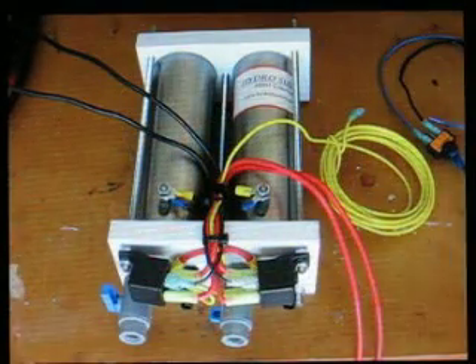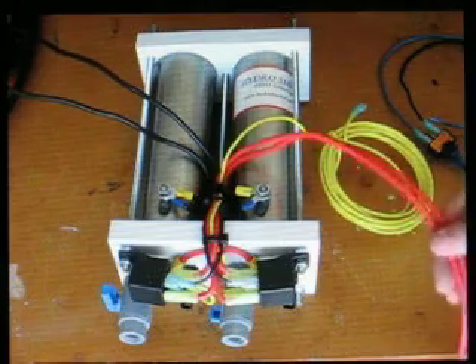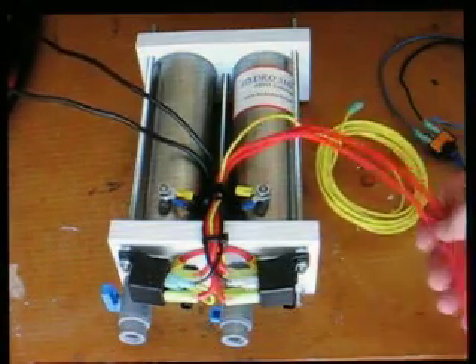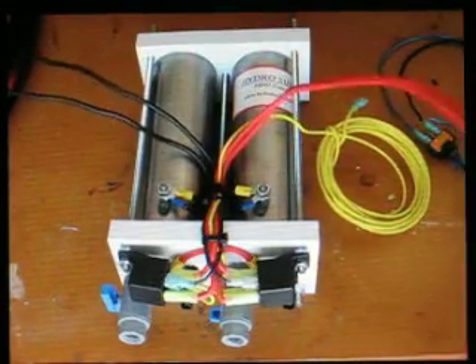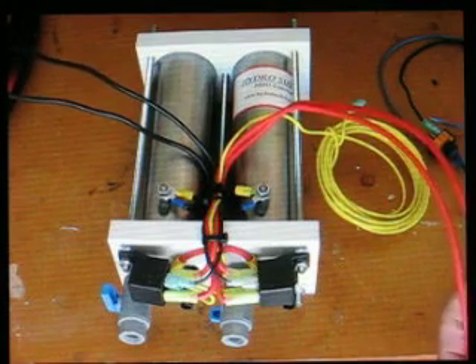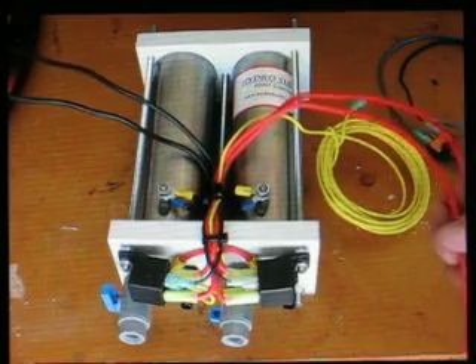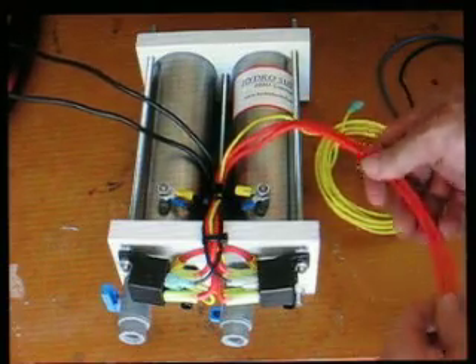Now she's all back together. We've let the wiring loom go. Looks like pretty heavy-duty wiring, especially for the unit ground and the positive cables that we're going to hook up to the back of the alternator. I'm running a 220-amp alternator on the Tahoe. That should be plenty of power for everything else that we're doing with it.